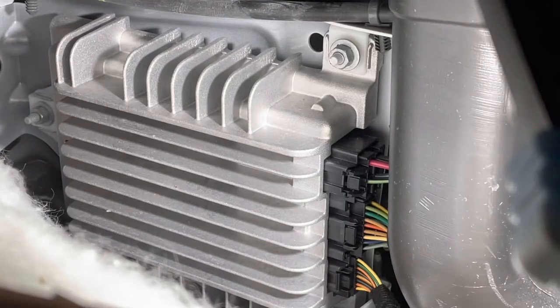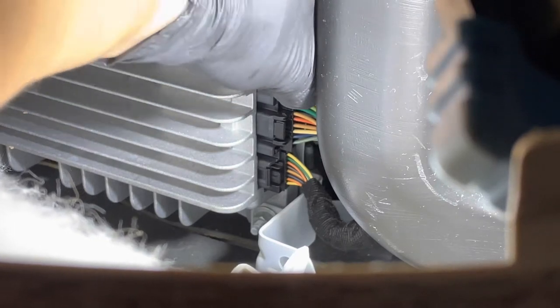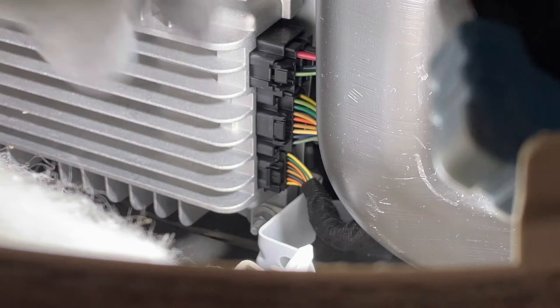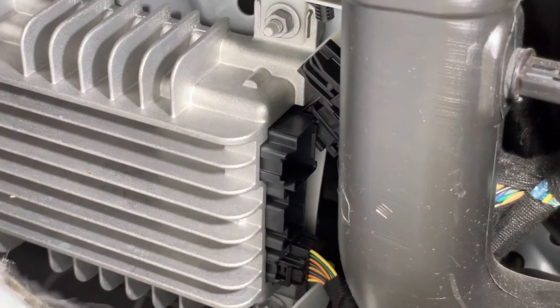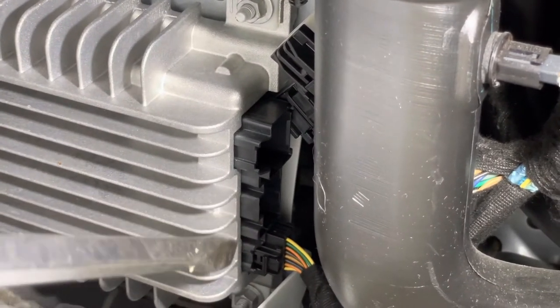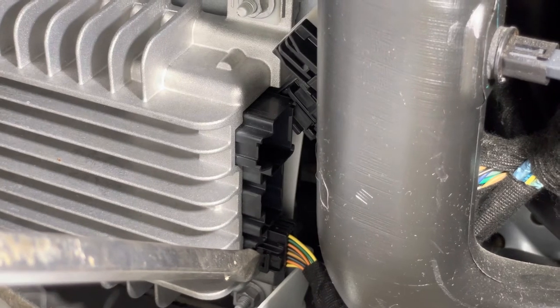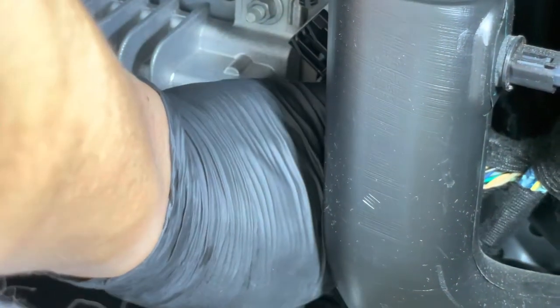Let me try to zoom in. Looks like a standard harness, so push and pull I assume. I'm going to stop recording but just push and pull these out. So here's the first one. The hardest one so far is going to be this very bottom one. What I did was take a really long screwdriver, press that little tab in where I'm pointing to, and then put the flat blade screwdriver under it to softly wedge it until it unseats, and then you can pull it off with your hand — like that.